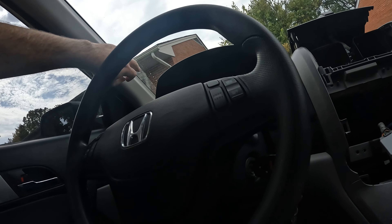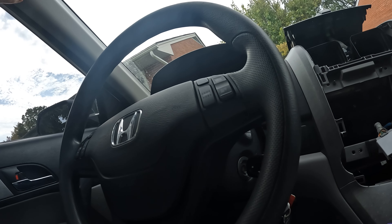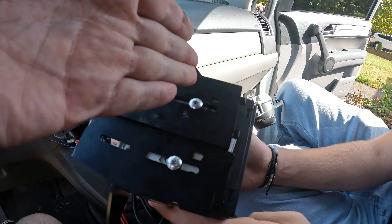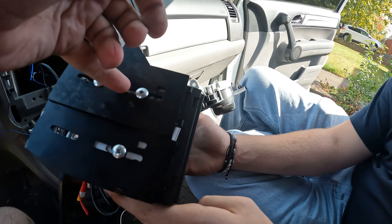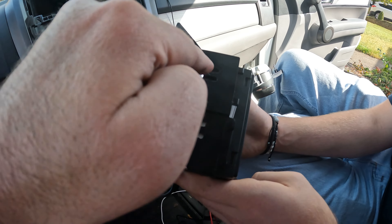Okay, so we got all of our wiring done. I always like to test the stereo before we go back in there. We've got everything plugged in. I know you can't hear the static, but also the steering wheel controls work. Everything works. So now we're going to unplug this, wrap some of these with electrical tape, get the mount made, and then get everything back together.